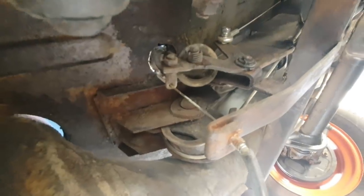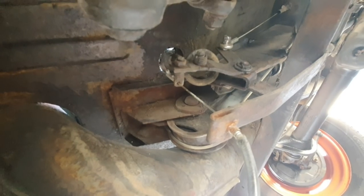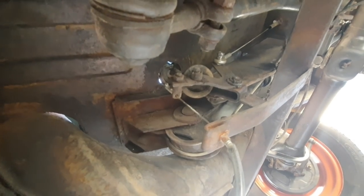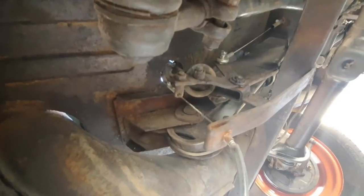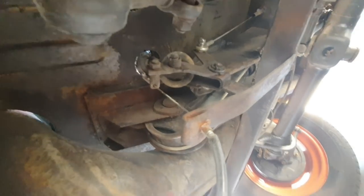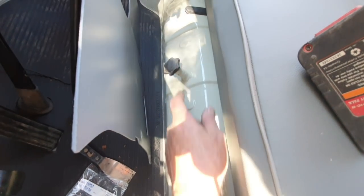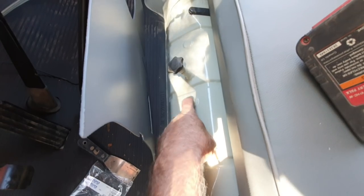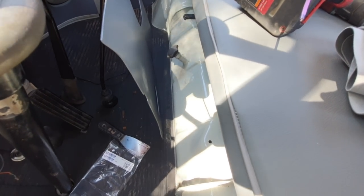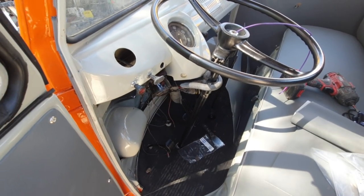That was pretty neat. You could use this on my other cars — I have big engines with chokes but no fast idle, and it's always a pain in the morning when I go to start it. You could just use a stock choke cable from an early bus or bug, shorten the cable, and put it in the same spot as your reserve switch on the floor. Drill a hole, put the stock knob on — you wouldn't even notice it wasn't original.